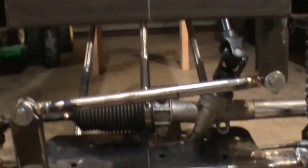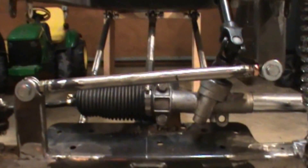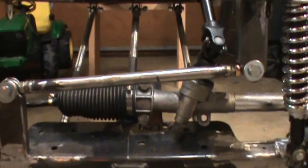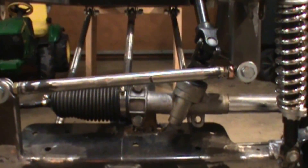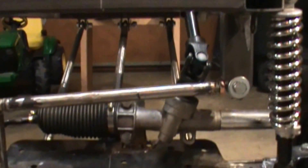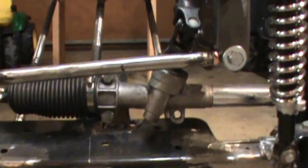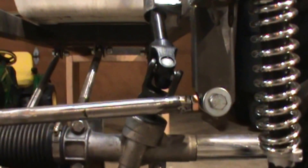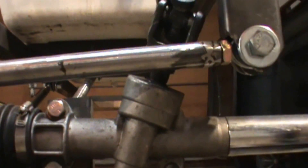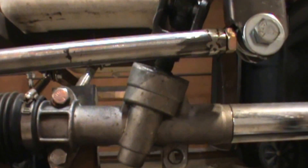With the rack and pinion here on the TXT EasyGo, it normally mounts flat against the axle. What I ended up doing is I made a bracket out of two by two by eighth inch angle iron and bolted it so it was standing up at a 15 degree angle. The reason why I did that is the output on the rack and pinion put it at a really bad angle where I would have had to scoot the cooler way far back.